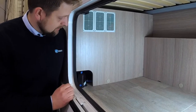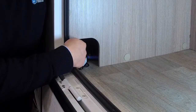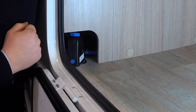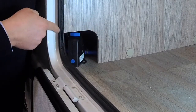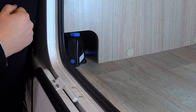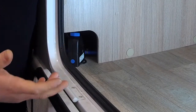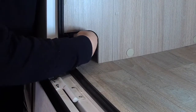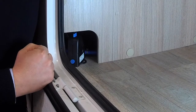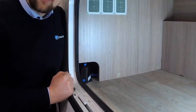The way to check it is by looking at the switch on the top of the frost control. It should be transverse to the frost control. And the blue button must be pressed down. The frost control is then locked. If you want to discharge the hot water, or it gets cold and it drains automatically, the switch then turns along the frost control, and the blue button pops out. All the hot water then drains out of the vehicle.